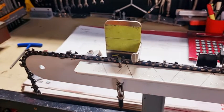So just to recap, for those people out there that cannot get their hands on a progressive depth gauge, would like to try and make their rakers more efficient, for every millimetre that you grind off your tooth, go down 0.1 of a millimetre extra than what you've already got. Out of the box, your depth gauge will be set at 0.65 of a millimetre. If you remove 1 mil of tooth, you'll add an additional 0.1 of a millimetre. That would mean you'd increase from 0.65 to 0.75 for the first millimetre that you remove off a brand new chain. I hope that helps.